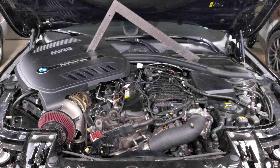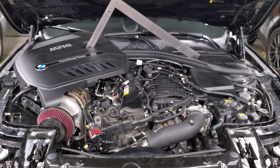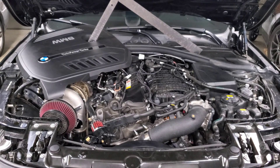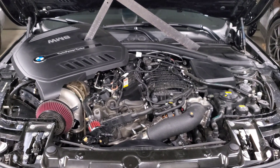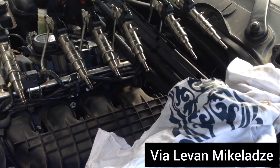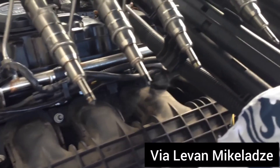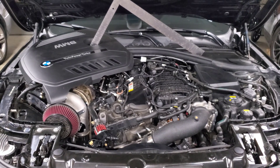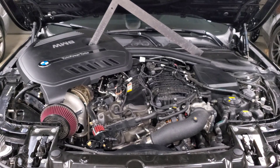There are a couple of ways to check if the injector is stuck open. Remove the spark plug - if it's wet and smells like fuel, that cylinder is likely running rich. You can also run logs to check your AFRs, because a consistently richer AFR than your target can indicate excess fuel. Another method is to remove the entire fuel rail, point the injectors into a bucket, unplug them so they should be closed, and start the car. The car won't start but while cranking you can check if any fuel comes out - because with no power the injector should be normally closed.